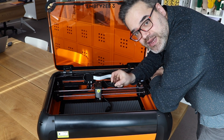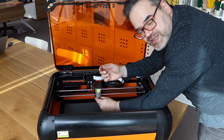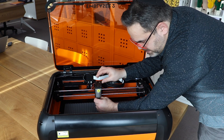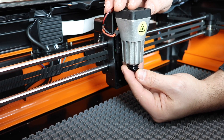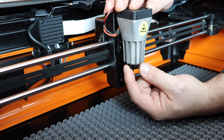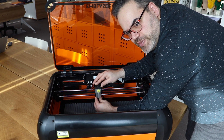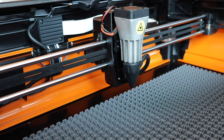I've cleaned the lens and it's all ready to go back in, so I just reverse the process to reassemble the machine. I turn it to the left — I'm just playing with the thread because what I don't want to do is force it on there. It is made out of aluminium, so it is metal, but at the same time you don't want to re-thread anything. I think I've got it — yep. Now if I were to touch the lens, I'd have to re-clean the whole thing, so just be a little careful. I tighten it up — you don't have to make it super tight, but go all the way to the threads and give it a little bit of pressure. Then take the hood and squish it back on — and that is done.